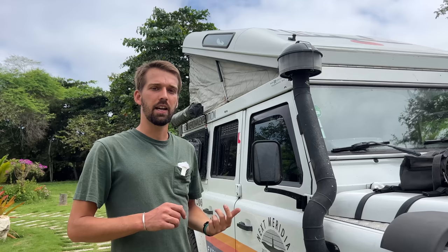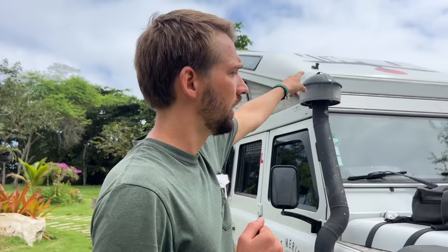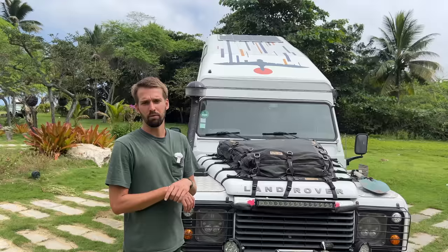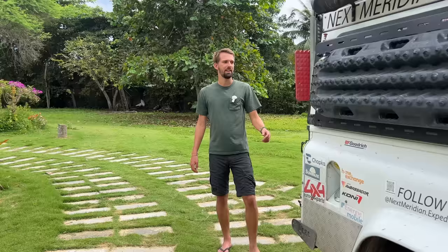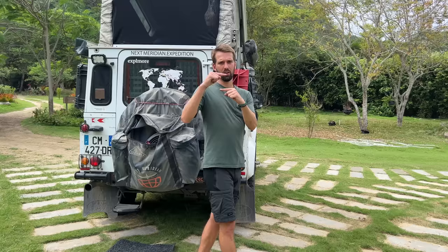The forward and rear-facing snorkels are perfect too, but I think the cyclonic one removes more air pollution from getting into your air filter and then into the engine. You can also see we have a pop-up roof. The idea is to be able to stand inside in case it was raining or we just wanted to be indoors without being crouched down in a 4x4. On the roof you'll notice a solar panel from Sunware, a German company — it's a 100-watt panel. We drive practically every day so we don't technically need so much power. We also have a second plug-and-play 100-watt panel inside, giving us 200 watts total, which has been sufficient.